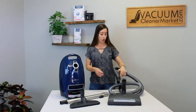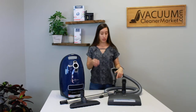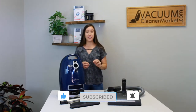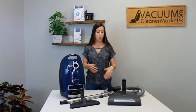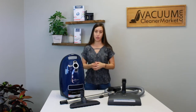This is your hose. Your hose has a button on it with an X and an O. The X will turn your spinning brush roll on your carpeting power head on when it's attached to the wand. The O — think 'off' — turns the spinning brush roll off. This is useful if you have a rug with tassels or delicate carpeting that can't handle a spinning brush roll. Push the button to O to vacuum via pure suction, then turn the brush roll back on for a deep clean on carpeted surfaces.